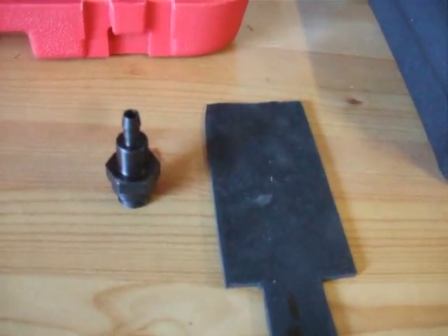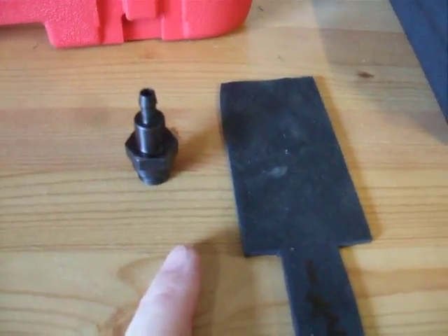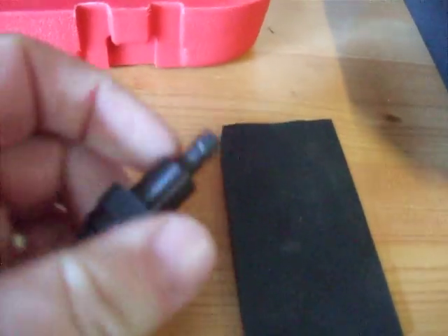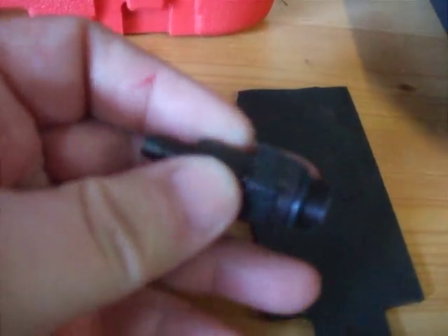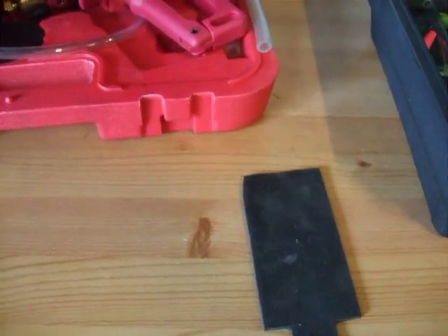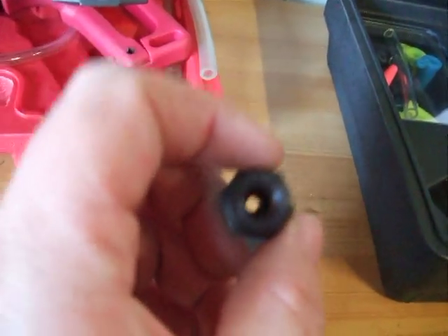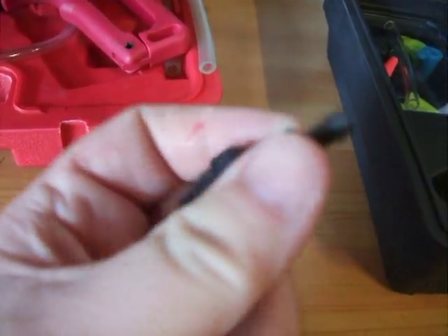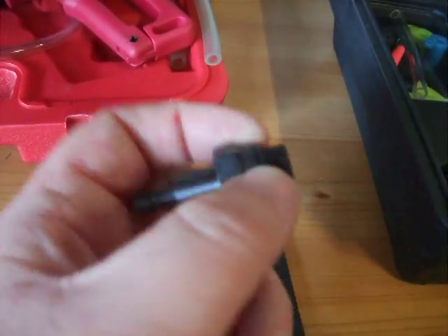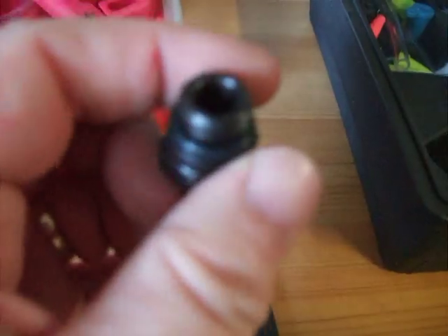Also, I'll do some videos of some tests so you'll understand what these bits are for. This looks like a spark plug — it doesn't have to look like one, that's just how it comes. On a compression test you try to get the compression by turning the engine over with a gauge plugged into the spark plug hole. You have a similar thing with this, but it's for putting pressure in, not taking it out. So this screws in — it's just an easy way of connecting your pipe to the engine. The important thing is: when you do one of these tests, the engine doesn't turn over. I've seen loads of people turn the engine over on various YouTube videos when they're doing a two stroke leak down test, and if it does that it would actually be a fail — even though people say 'oh look, you can see the pressure moving.' Yes, that means it's a fail.